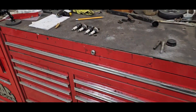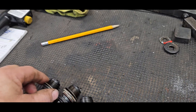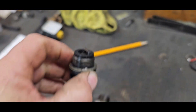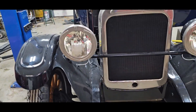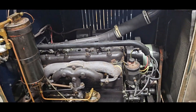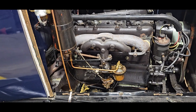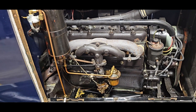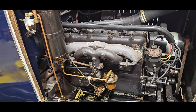I'm keeping my fingers crossed - these plugs were saturated when I tried to start it yesterday. I'm thinking it's just because it had garbage gas that fouled the plugs, so I'm going to clean these up. I'll get the battery reconnected and hopefully get this started up. It's got a quarter tank of fuel in the back - I might have to drain that and get some fresh fuel in here.